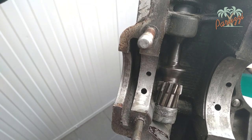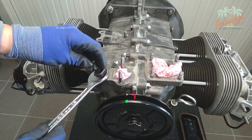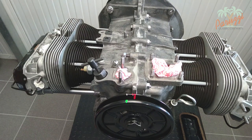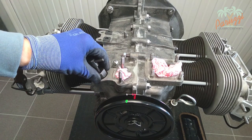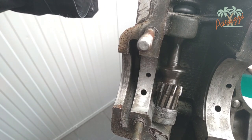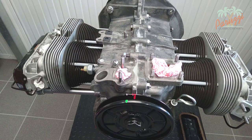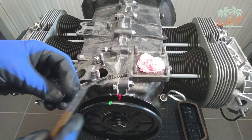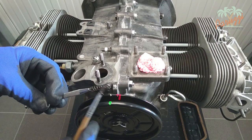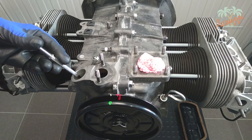Be careful not to move the shims while installing the drive shaft. The drive shaft may be rotated slightly counterclockwise — it will rotate clockwise as it slides down and engages with the teeth of the crankshaft gear. Turn the handle of the special tool to loosen it from the drive shaft. If all went well, the distributor drive shaft is in place. The red mark on the crankshaft pulley indicating that cylinder 1 will ignite is still aligned with the two crankcase halves. Don't forget the spring — with a little grease on the bottom, move the spring into place with a small gripper. The grease will ensure that the spring stays in place.